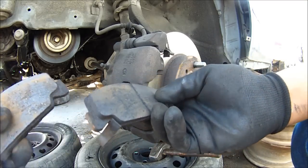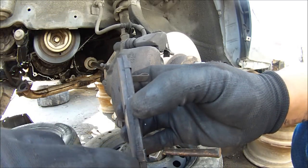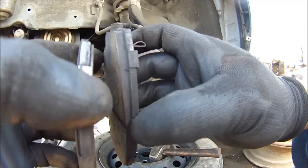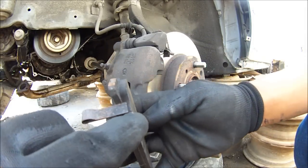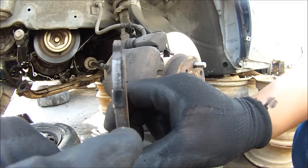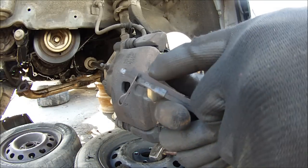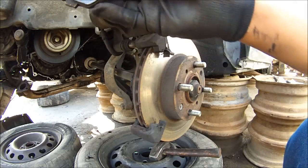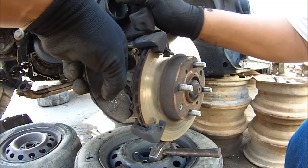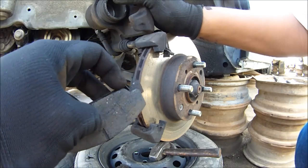I'm looking at the thickness right here on this edge - that's too worn out. These will work because it hasn't passed the brake wear indicator yet, but they'll just wear out real fast. This one's almost ready to start touching the rotor. Once they start wearing out, this little brake wear indicator will start rubbing on the rotor like that and it'll start squeaking. You've all heard that brake squeak in people's cars - that's where it comes from, the brake wear indicator.